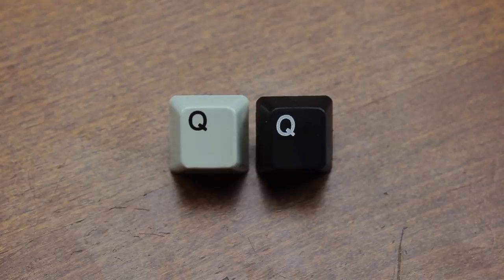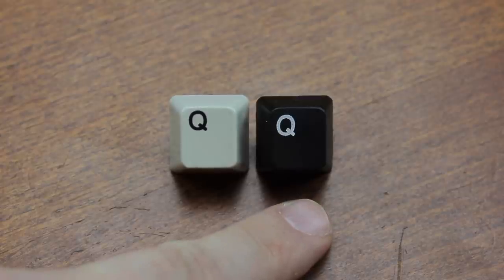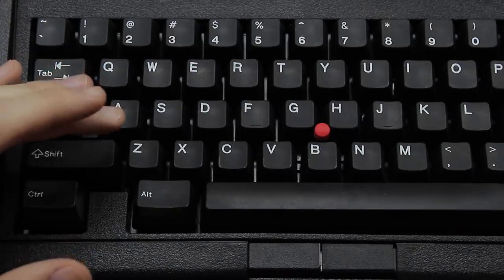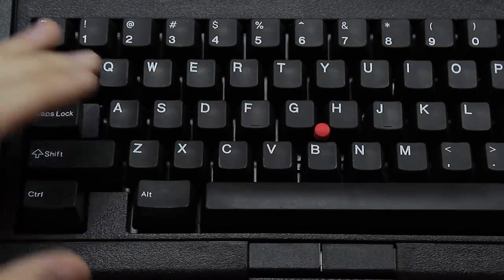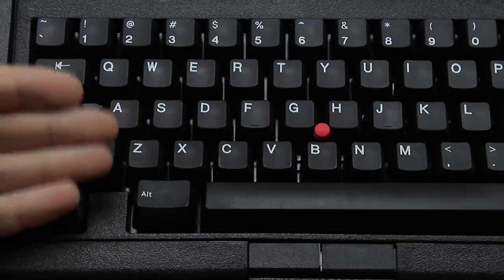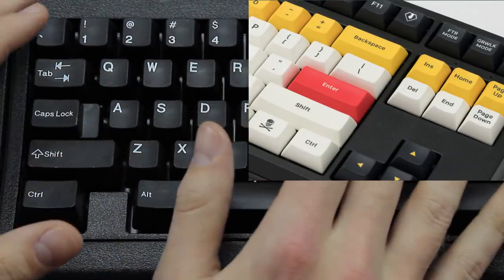Just. I absolutely had to have a clean one with relatively little use on the clock as well, because what many people don't know, or overlook, is that unlike the extremely durable dye-sublimed lettering of the standard Model M, the black version of the M13 uses what appears to be either pad-printed or silk-screened legends, which both have a much shorter lifetime than dye sublimation. This makes sense when you think about it, because dye sublimation works by diffusing an ink into the plastic, so you can obviously only use a dye that's darker than the host material, which is why you can't dye sub black caps. Unless you inverse dye sub them, but that seems to be a completely new thing.